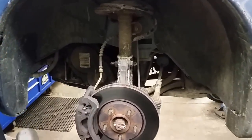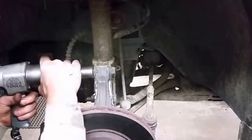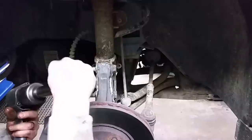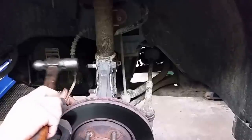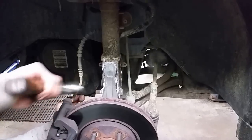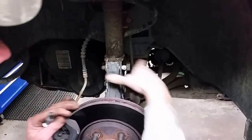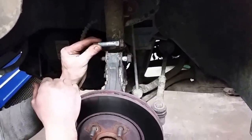I've already sprayed them with a little bit of our favorite panther pee. This is New York State — we use a lot of salt, so things get rusty pretty quick. We're going to go ahead and take that one out, take that one out. Like I said, they are splined, so just grab a hammer and hit them right directly on the end — they'll go flying. Simple as that. Now grab your bolt, stick one back in loosely on the control arm. You can see what I was saying about those bolts being splined — they lock right there in the steering knuckle pretty good.